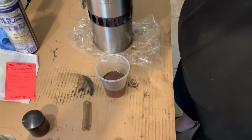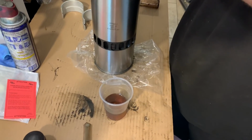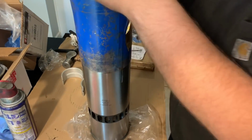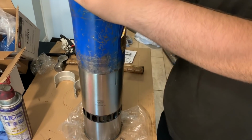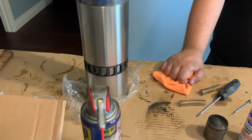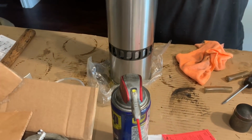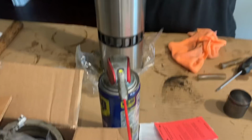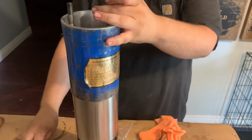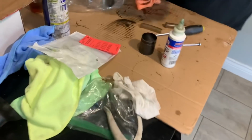And you got everything staggered on there correctly? Mm-hmm. Okay. One movement. Is it hard? Yeah, it's coming back up. All right, we're going to check the oil control. So we just pushed it right on down in there, and it's now in place. We can remove the ring compressor. Take the nuts off. You also can't have the rod cap on when you do it, or it doesn't come off. So that liner is ready to be loaded.